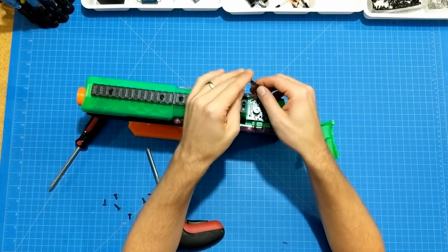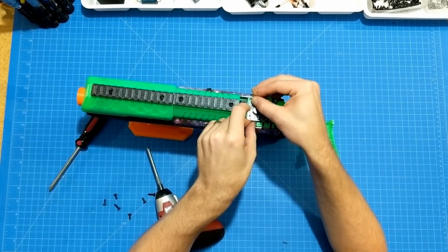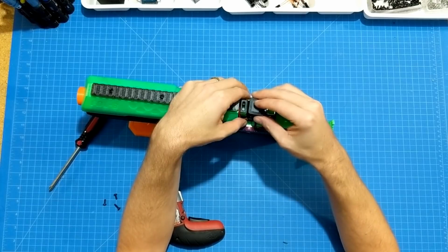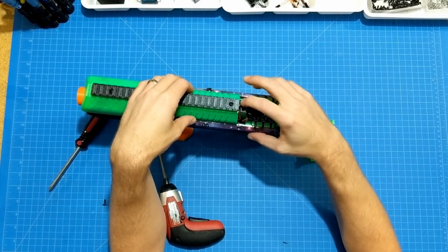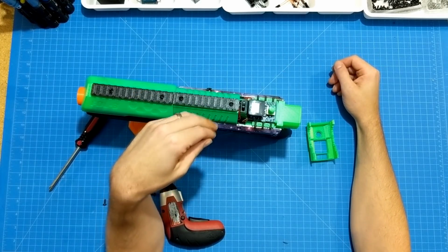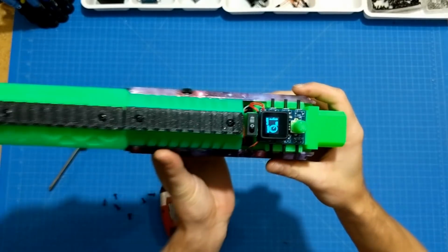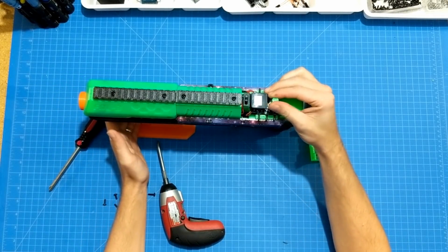So now we have this lock installed. You can put it back where it was, kind of inside the screen, or you can put it just in front of the screen, and then tuck these wires away to the side and replace your screen. Now, when I boot this up, it does the typical 3 beeps, but then there's also 2 beeps. And if you look close at this, in the upper corner there, it says S-lock. So that is an indication that you are in S-lock right now and your settings have been locked out.